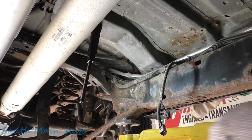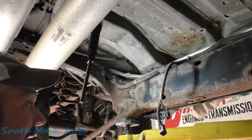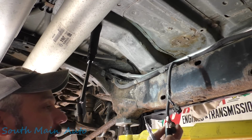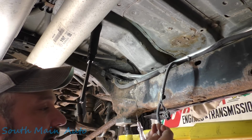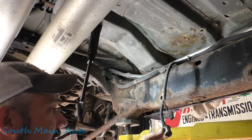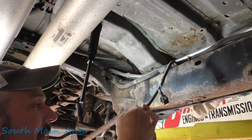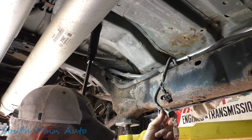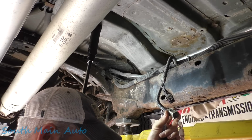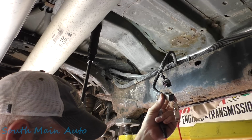Now that we've all learned the lesson, what not to do, I want to make sure that the low reference for the fuel level sensor is good, so I'm just gonna use a 75 milliamp test light here. We're gonna go to the fuel pump power, that's the gray. I'm gonna turn that back on. Gotta get back in the scan tool. It powered down on me here.